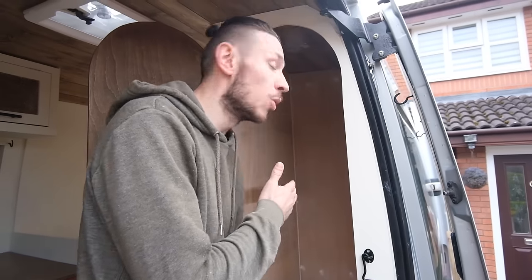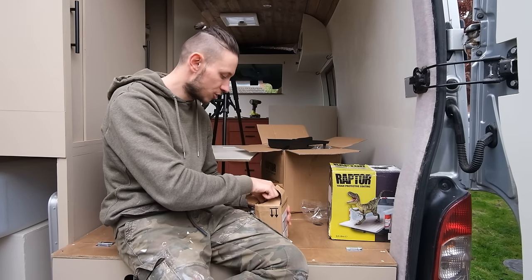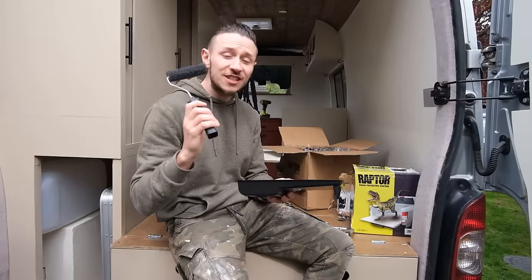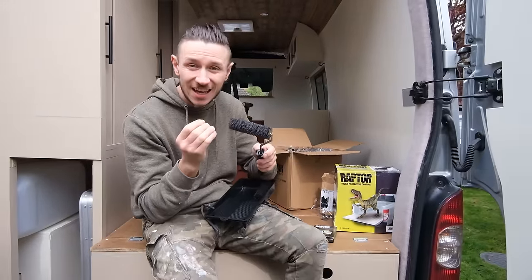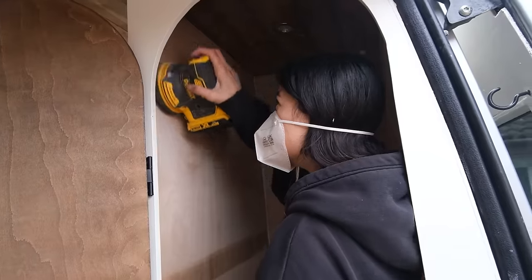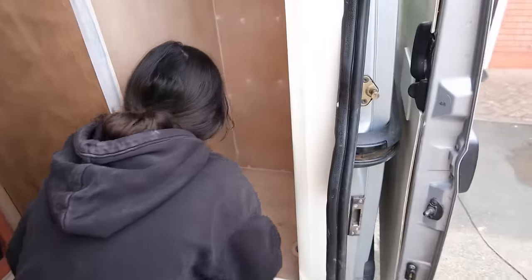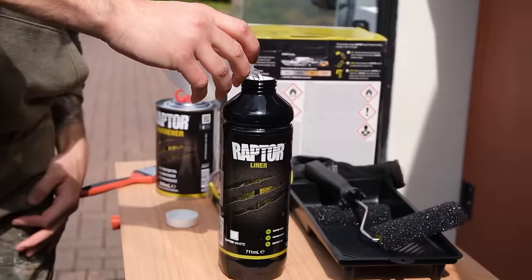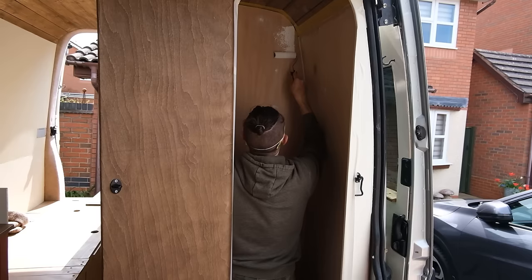With Raptor! We've got four bottles of white protective coating, some sachets of beige colour to add to our white, and trays with rollers. These rollers are quite textured, making them better to use with Raptor because it's very thick and tacky. Massive shout out to the Raptor guys for sorting us out with all this gear. To prep the space, we need to sand it down and vacuum it — we don't want any dust left behind. There's loads of preparation to go into Raptor painting. We also need to prep the paint, which is a three-to-one ratio of three Raptor to one Hardener. This is all explained on the website and on the box, and we'll link to their website in the description.